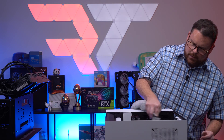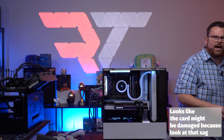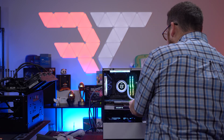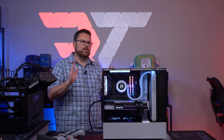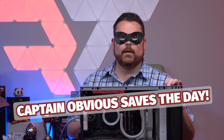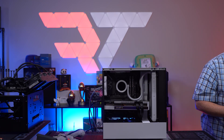See if it actually boots. Okay, so we got power but no graphics whatsoever. So what we're going to do now is turn it off, grab another GPU, and see if we get the same problem.